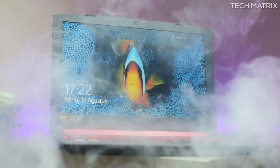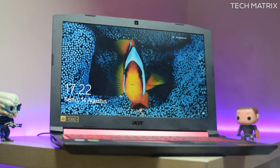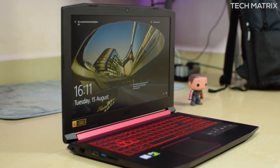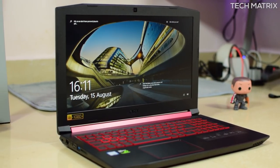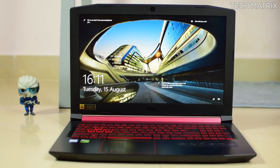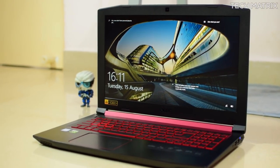For connectivity, it has Intel dual band wireless LAN 802.11ac, A, B, G and N and operates at 2.4 and 5GHz as well. It also has Bluetooth 4 built-in. The display is a 15.6-inch full HD wide 170-degree IPS LCD display with 16:9 aspect ratio. The colors are vivid and are true to life but the brightness is a tad dim, could have been a bit brighter. Although the viewing angles are decent, at points you may notice a bit of color difference.